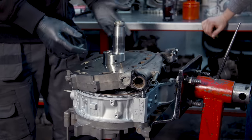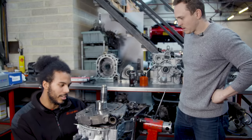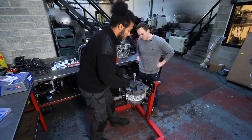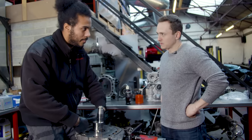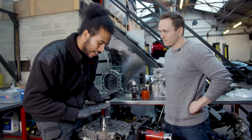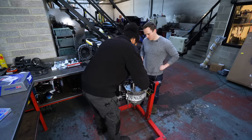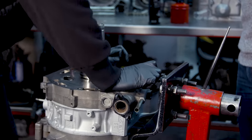This is a tedious bit because some people just get stuck. Sometimes people get a second person to do it, but we've done this enough times that we just do it like that. It's all dependent on how you position the rotor on the iron. What I tend to do is have the rotor pointing towards the ports basically. As the centre iron comes down, it tilts like that — there's just enough space for it to lift the e-shaft a little bit and it won't actually contact where the sealant is.